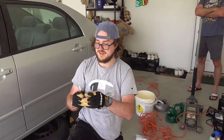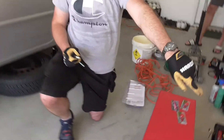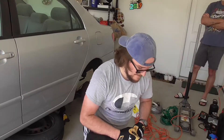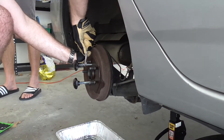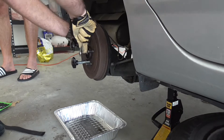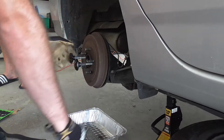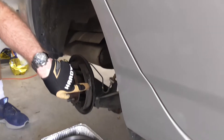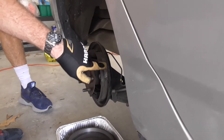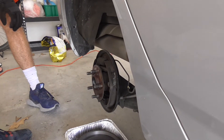With your Toyota, there are actually little holes where if you screw bolts into the drum it'll pop it off. But if it doesn't come off, or if you don't have those, you can use a dead blow hammer to bash it off. We need to pop these off and install the new parts. You really need to do drum brakes — this was all the way down to metal. See how it's got some material there and then just straight metal? So metal on metal — this was trashed. Like I said, they've been squealing.